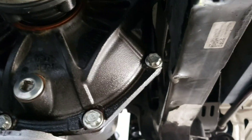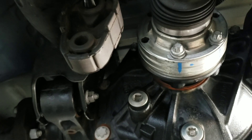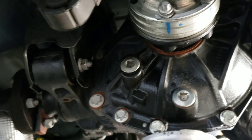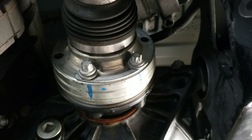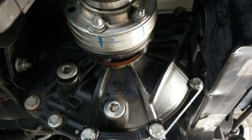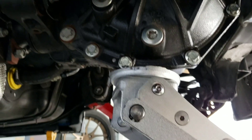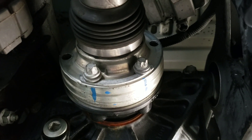I'm not going to do a video on removing my exhaust because how mine mounts up at the front is completely different from anyone else's. Once I'm done I need to go into the tune, put in my gear ratios, and figure out what else needs to be changed, then take it for a test drive. I can put in the gear ratio in the tune without changing any of my RPM shift points and just manual shift for now. We should have shorter first, second, third gears and hopefully get a better launch out of this. That's pretty much going to wrap up this video — just need to tighten down the bolts.